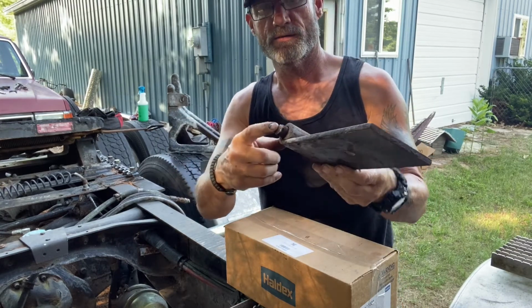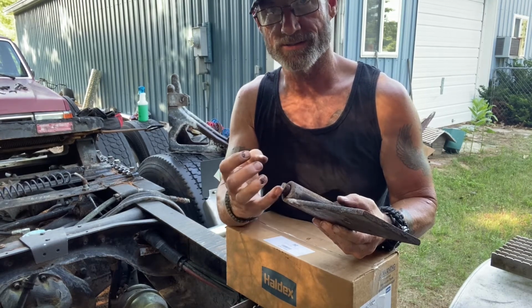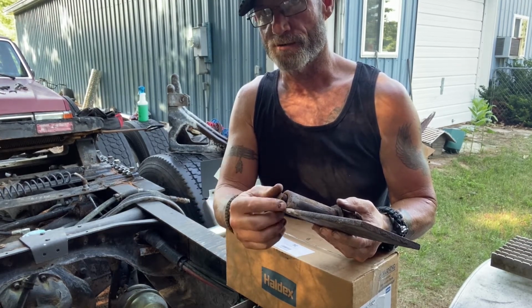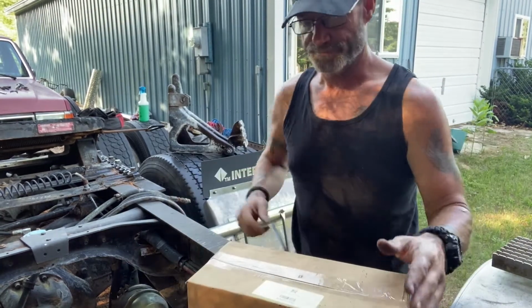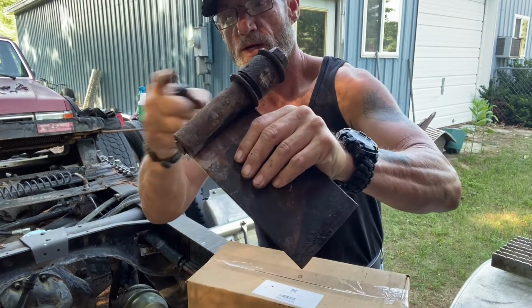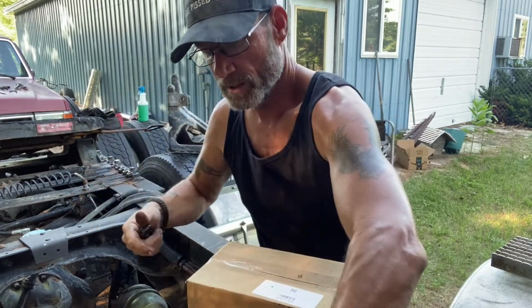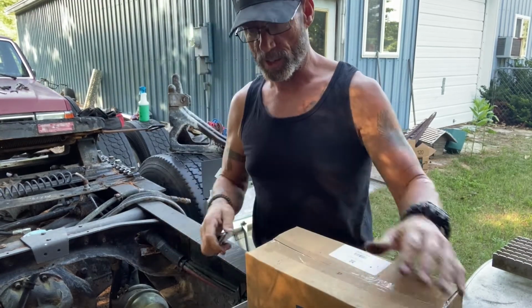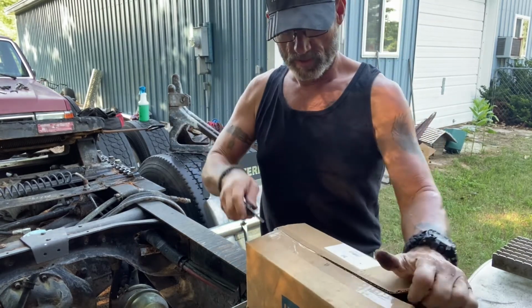And then on the back side, there wasn't a bolt, there was just a nut. I think it's a special nut that tightens down as you tighten it, so it can't back off by itself whatsoever. But where am I going to find a nut like that? Maybe international, I'm going to try to find one. Otherwise, I'll just put another washer like this one on this side, then a lock washer, and then another hardened bolt. That should be good enough. But if I can find shock bolts still at the dealership, then I'll get them, because they'll have the proper nuts.